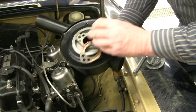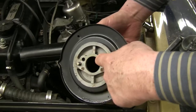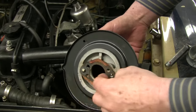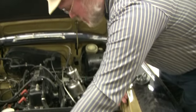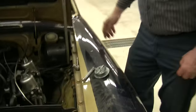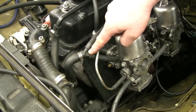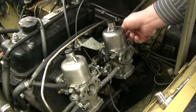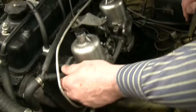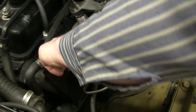Let's take a look at it. Is it hooked up the same? Yes. The breather holes here are at the top — that is essential. If that doesn't happen, the carburetor isn't going to work correctly. We've got our front tappet inspection cover coming through the 12G2134 plastic Y piece and venting into the rear of the rear carb and into the front of the front carb. This is how the engine ventilates.